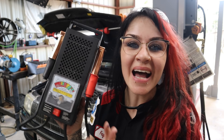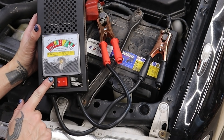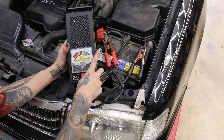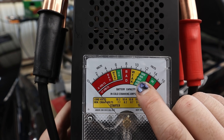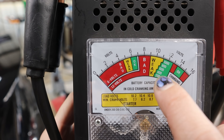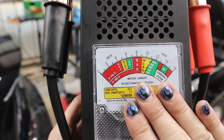Now let's test the battery. We're going to put the battery under a load test. I like this tester because it actually does load the battery — it's got this crazy little coil that actually gets kind of hot, so be careful. If you don't have one of these, you can go to AutoZone, O'Reilly's — any auto parts store should be able to test your battery for you for free. Make sure those clamps are on there nice and tight, apply a load, and we can see that it is absolutely testing in the green. There's a little bit of smoke coming off because we're loading the battery with coils inside. Looking closer, you can see it's going to show the cold cranking amps — 550 CCA for that battery, testing in the green between 600 and 400. Under a load, this battery does test good. Starting with a good battery is very, very important.